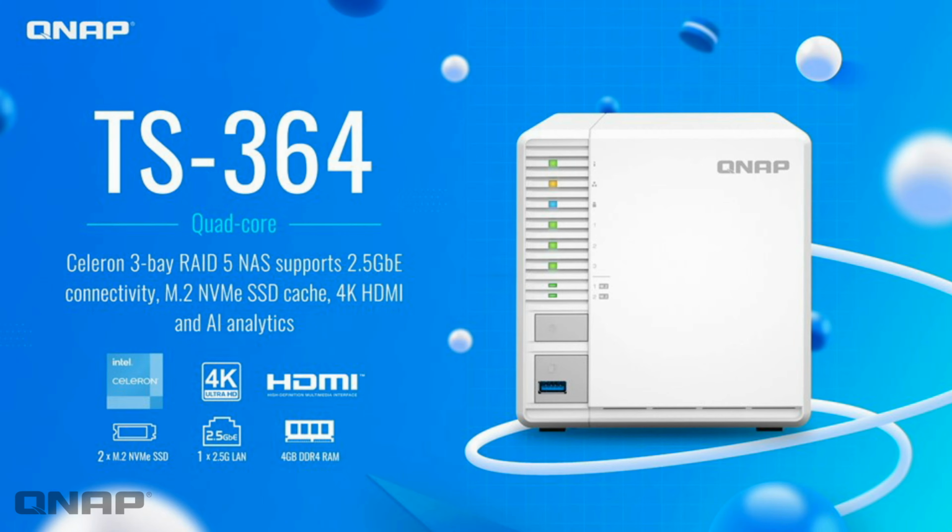Now today I'd like to introduce one of our new products, which is the TS-364. This is a 3-bay NAS, so it's got 3 main drive bays, which is the minimum number of drives you need for RAID 5. So you can enable RAID 5, probably the most popular RAID mode, by using the fewest number of disks possible. You don't have to jump up to a 4-bay to get the RAID 5 from the 2-bay. We put this one right in the middle.